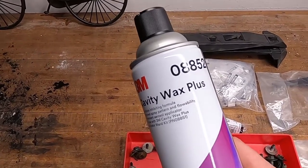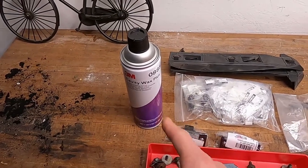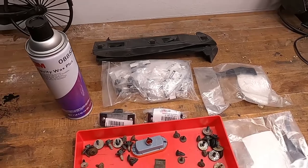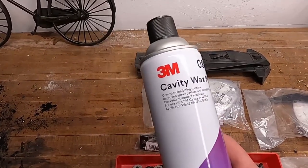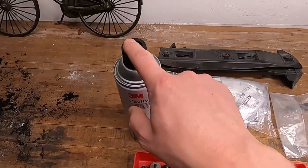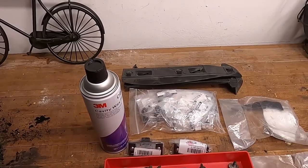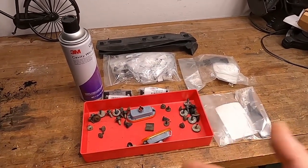This is what the guy at the body shop recommended I do. The hatch is fixed and the other parts are fixed, but it's not a bad idea to spray that in there to keep it from getting any rust in the future. I'm not driving in the winter anymore, but I don't want to take any chances. You can buy this pretty much anywhere, and I'm just waiting on the applicator to come in because I want to be able to snake it inside the hatch and get it in the bottom there. Just a couple other details I'm doing since I'm in here replacing so much anyway.